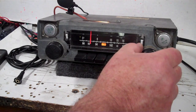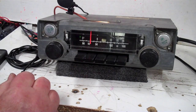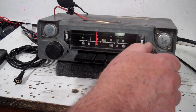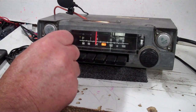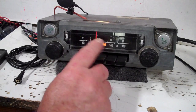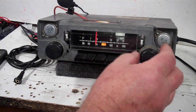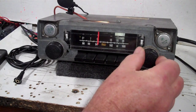Right now you're on FM. Now you're on AM radio. Back to FM, and what we've done, we've got an operating LED here. It tells you where the radio is at when you switch it. The FM light, when you turn it to the FM, we put the stereo light in behind there. That way when you hit a stereo channel, it will light up for you.